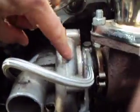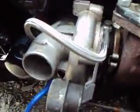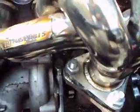The intake side, which has got the impeller in it — which is this side — is held together with a big circlip. You'll need a tool to actually grip onto that, pull it apart, and then you can rotate it to get the intake facing forward. You'll want the oil line coming from the top down, and then the oil will drain out the bottom back into the sump.